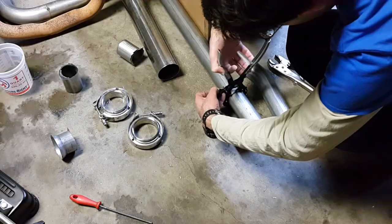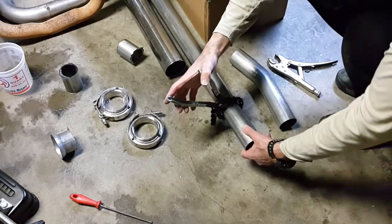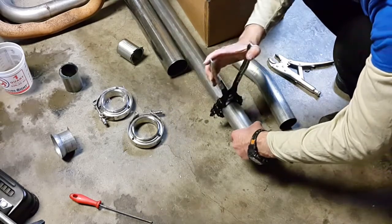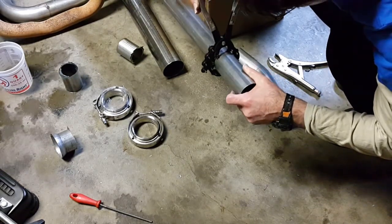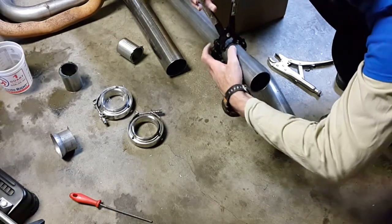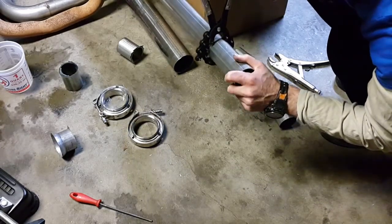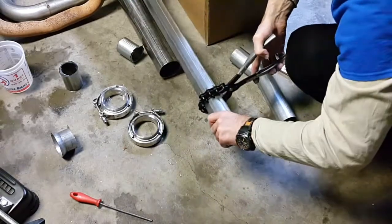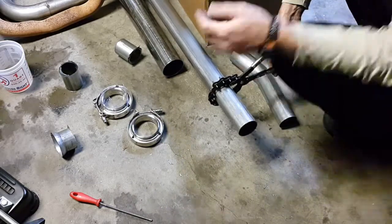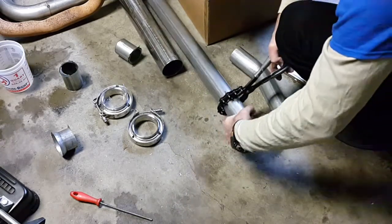As far as cutting pipe goes, this pipe cutter tool is excellent for cutting pups. You have to make sure it's perfectly square, otherwise you'll have a real problem. First, score the pipe very slightly, then check the score line to see if both wheels are going through the same score line — if they're not, you'll create a spiral cut. Move the wheel so both track the same score line. If you're under the car, the exhaust is clamped and you can cut from only one side, which is really useful for getting an old exhaust out.